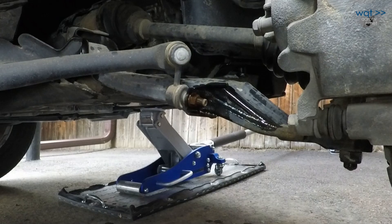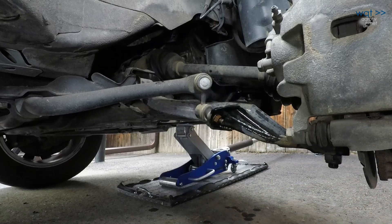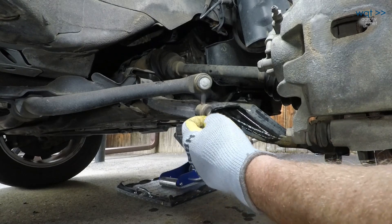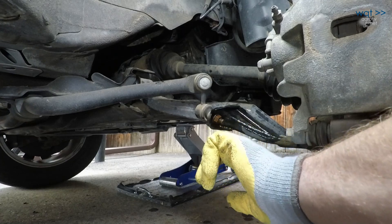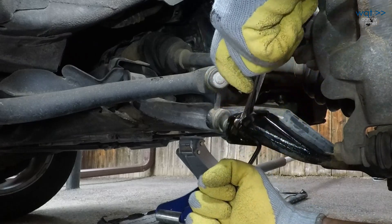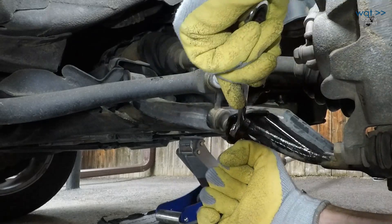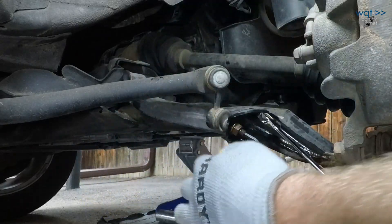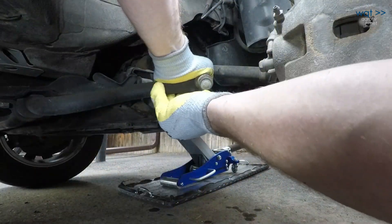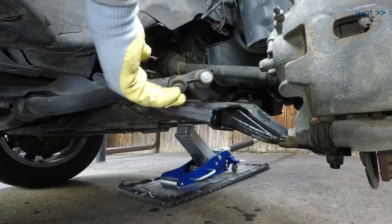This one here is a 15mm. We'll start and see if we can break the bolt without having to use a hex insert. Sometimes it works, sometimes it doesn't. I've got enough looseness here that I could try putting a vice grips back there. Normally you're supposed to put a hex key insert in here, but sometimes these rust out — so we'll see if that works. For those keeping score at home, this is a 5mm hex driver, and this is still a 15mm, but now I'm using an open-end box wrench because that's about all I can get in there. It's still turning — not as cooperatively as I'd hope, but I don't think I'll have to grind it off, which means I can save the sway bar end link. Those ball ones are still fairly tight; I don't see any tearing in the boots, so we'll be reusing this later. I'm just going to screw that back on there so I don't lose it.